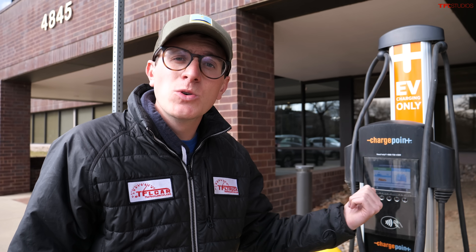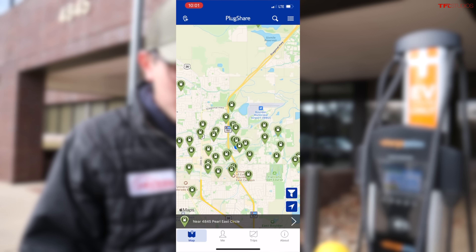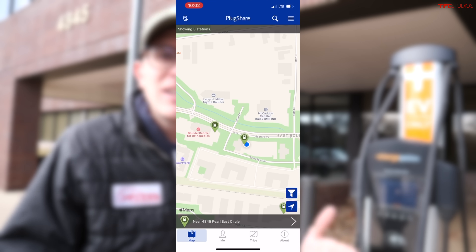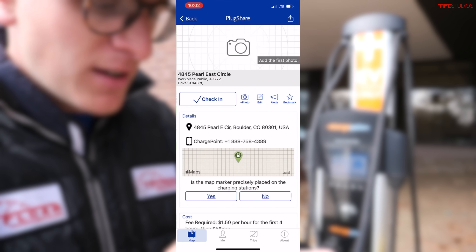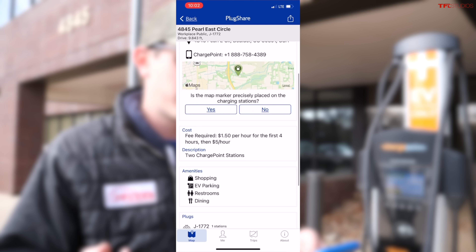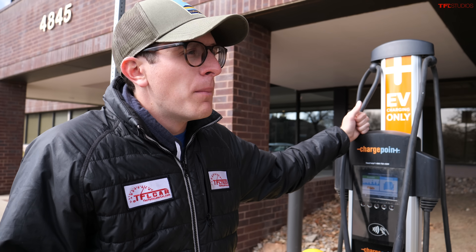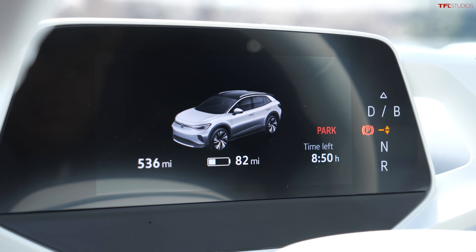You can go onto the charger individually to see how much it'll cost, or download an app like PlugShare — basically Facebook for EV drivers — where people publish how much different chargers cost. Here we can see this one is a dollar fifty per hour for the first four hours, then five dollars per hour after that, which could get pretty expensive. I only use these Level 2 public chargers if convenient. But what if you're on a road trip or don't have several hours to wait? We're going to have to step up to Level 3 — that's supercharging or fast charging.